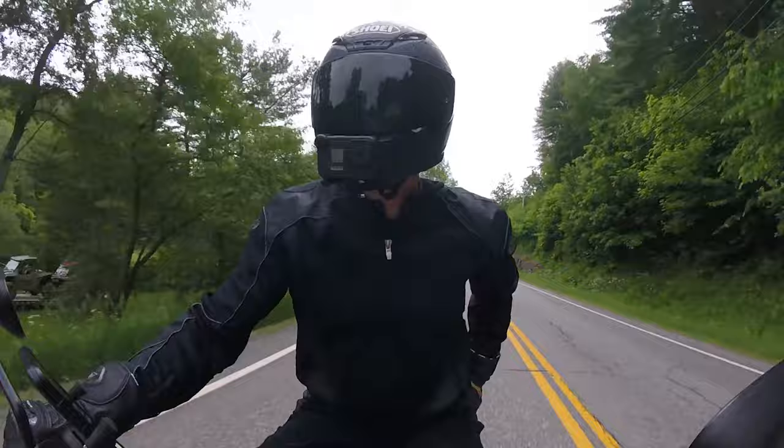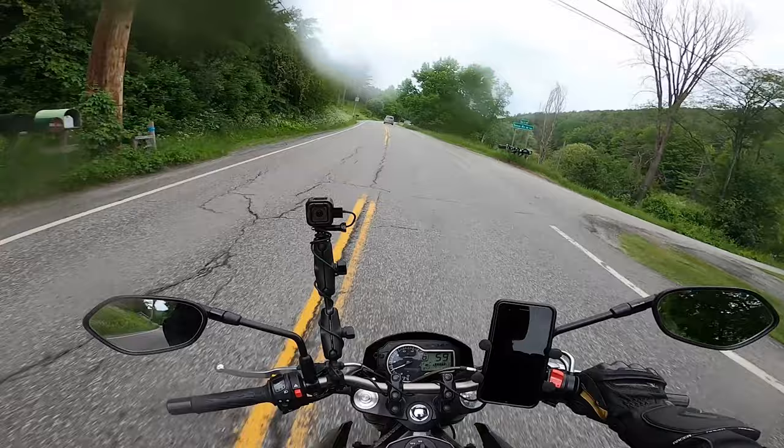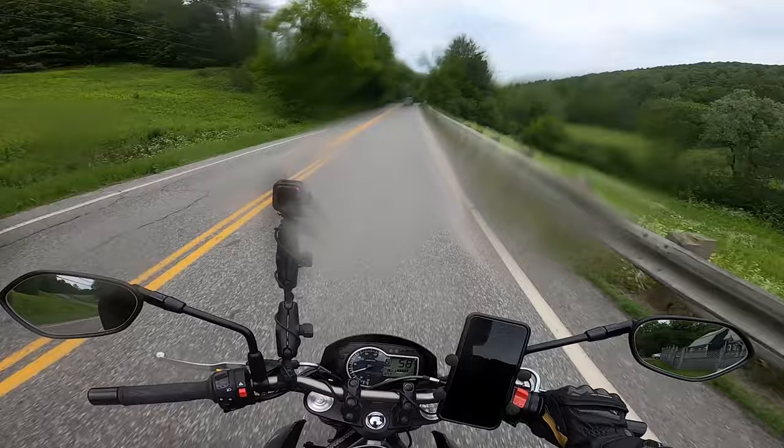So set your idle, 1350 RPM. Make it perfectly across the board with the sync tool. Everything level, everything perfect, exact vacuum pressure in each cylinder. Then adjust for around 4,000 RPM.